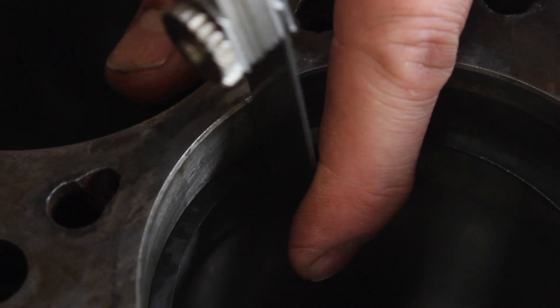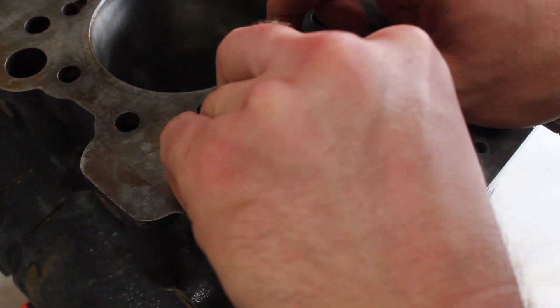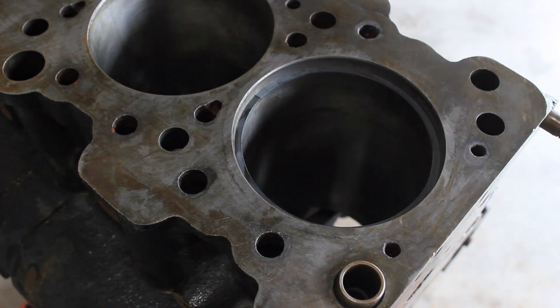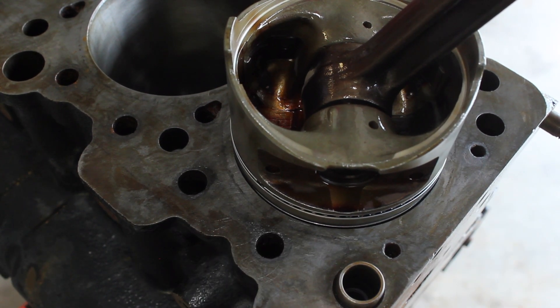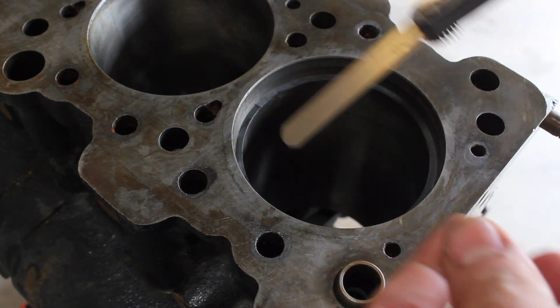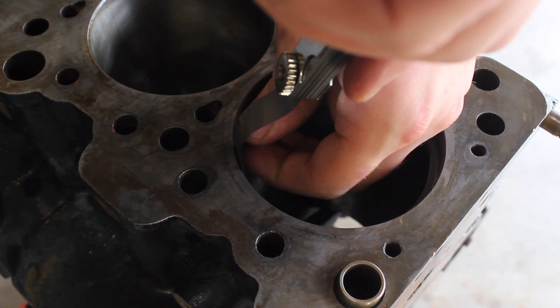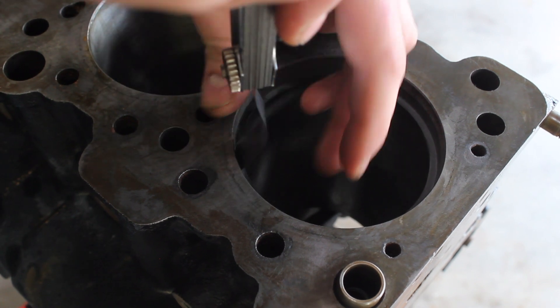If it's pulling up, it means it's a little tight — probably isn't a horrible thing. As far as the end gap, it does seem good, a little tight but usable. For the next ring down, do the same thing — push the piston into the cylinder wall, making sure it's level. I used the sides of the ring gaps to check it was the same all the way around, then slid in the two feeler gauges. Perfect — we can go back to putting on the piston rings.